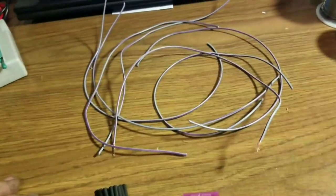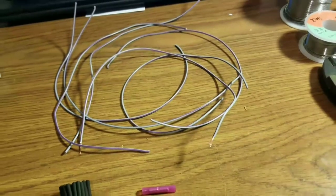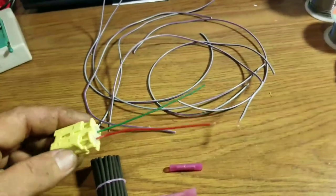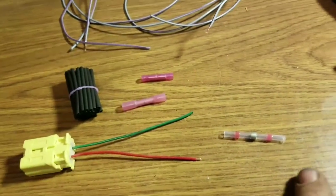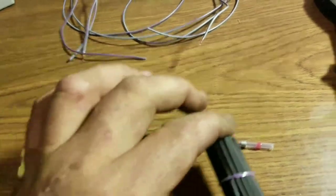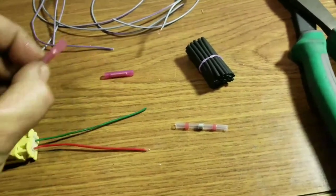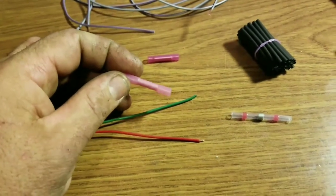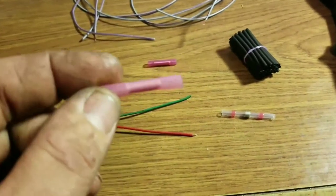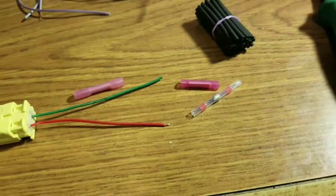What I have here is a bunch of BMW wires cut out of a harness I replaced — all the exact same kind of wire — and I've never seen a difference. I guess it just comes down to quality of repair and how you decide to do it. I love the solder seals, and if I don't use those I'll just solder and heat shrink with three-to-one. For something like a headlight, fog light, washer bottle, or tail light, it's perfectly fine to use the heat shrink butt connectors. I try to stay away from regular butt connectors altogether.